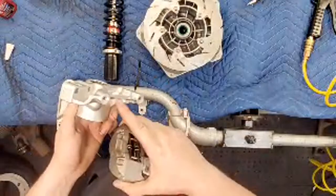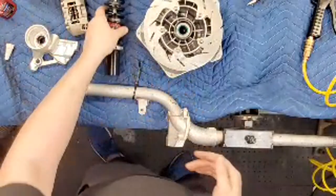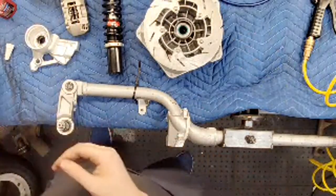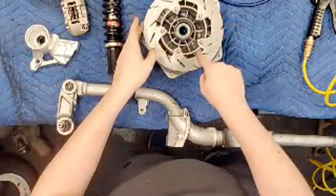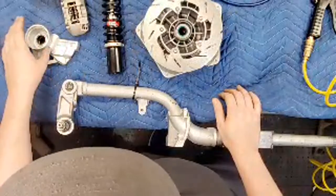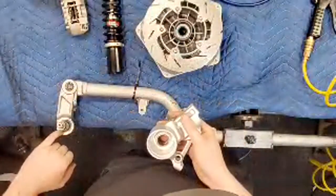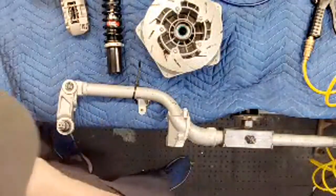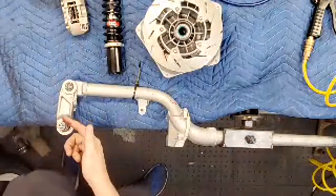With this radial mounting system, we're going to use a 4-piston Stage 6 caliper, a 185mm shock from YSS, and Spiegler brake line. I tightened these down on the other stream. For the disc, I used a little bit of Loctite and just tightened it down. I've already put the spacer and an O-ring in, so we're just gonna go and grease this up. Same with the axle, give it a little bit of grease.